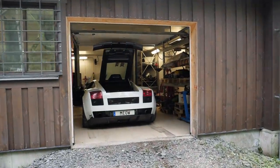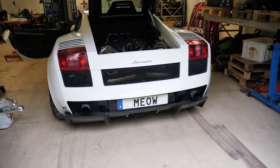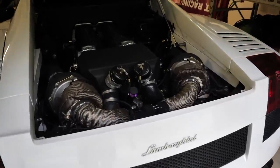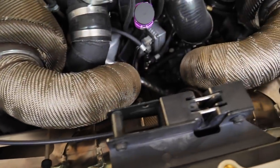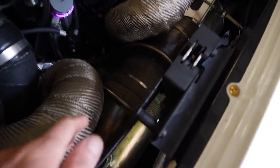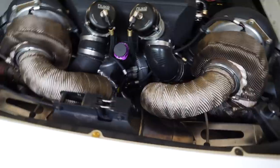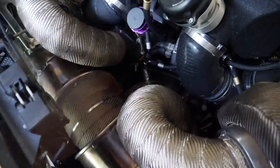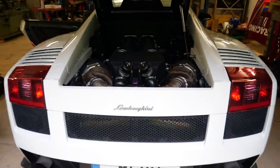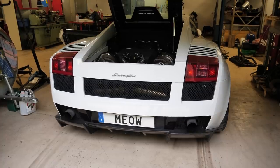One thing that bothers me is the sound of it. It doesn't sound as good as I was hoping, and if I compare to other Gallardo twin turbos I can see on the internet, the one I have here in the garage sounds a lot better. The problem I think is the exhaust — from the left hand turbo and right hand turbo they are not connected anywhere really. So what I will do is an X-pipe, so these will connect together, the pulses will be more even — 10 pulses out from the exhaust — and it will have the exotic sound back again. But first I will start it up so you can hear how it sounds before this modification.